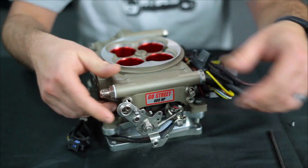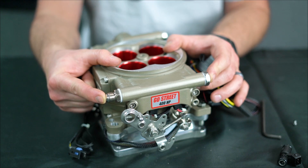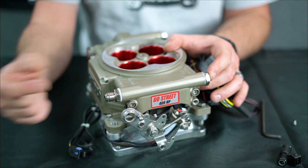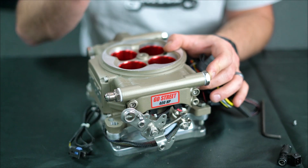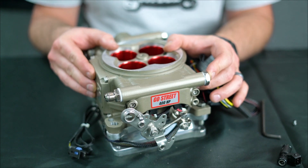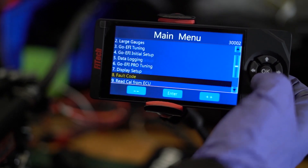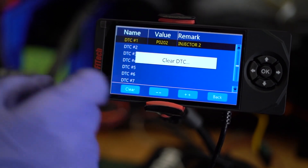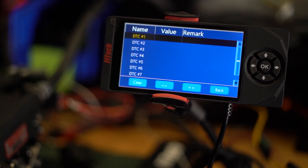Install your screws. Now that the fuel rail is reinstalled, hook up your inlet line again, key on, and double check for fuel leaks to make sure there are no fire hazards. Check for leaks where the injectors are and at your inlet fitting where you tightened it up. Once you're clear of any fuel leaks, go into the handheld under the fault code section and click clear faults in the lower left-hand corner to clear the injector fault. From there, you're ready to start your engine.